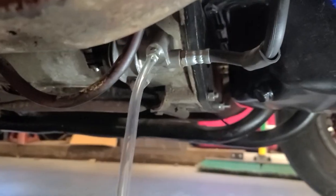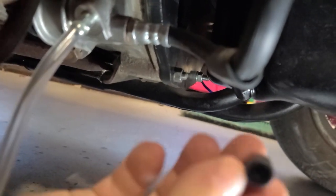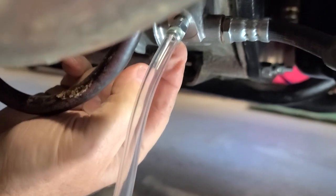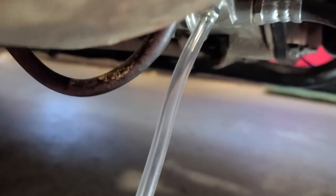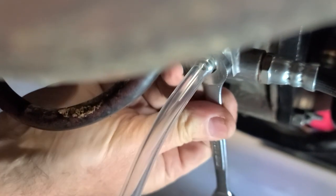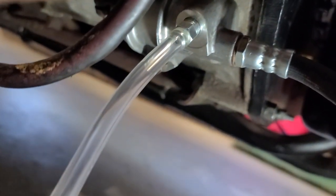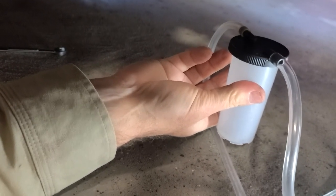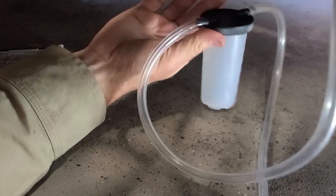Let's get underneath the car and start drawing some fluid. So here I am underneath the car — this is the slave cylinder for the clutch. The kit with this brake bleeding kit comes with these little boots that you can put onto the brake bleeders and they slide into the little vinyl tube. But in this case the vinyl tube fit just fine directly over it — it's a bit larger bleeder. I've got a little 7/16ths wrench and I just loosen it a little bit then tighten it back up lightly, so that it's ready to be easily loosened and tightened as needed. You notice on the pump it has this little reservoir — you don't want to allow any brake fluid to get back into the pump and damage the rubber seals because that will keep it from working right. This little reservoir will catch any spatters that come down through the tube.